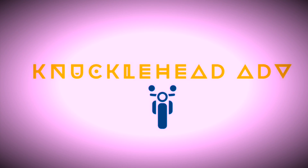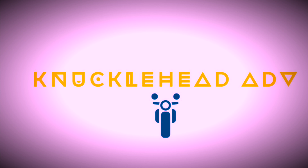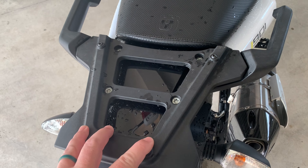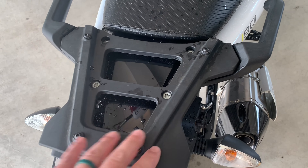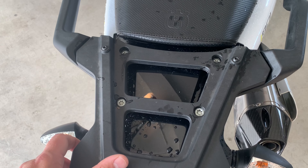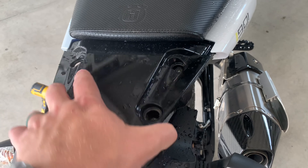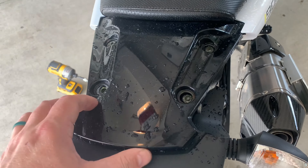So I just wanted to let you guys know. Alright, we're going to be removing the rack to get access to under this seat. Really, you don't need to mess with the bolts up here — you just have to take out these four here. So by removing those bolts, this whole piece will be loose, and you also have the rack off.